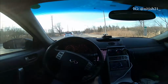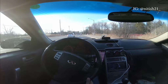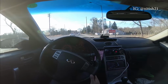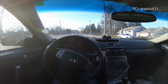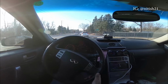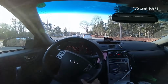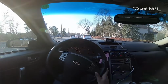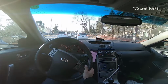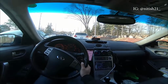Oil pump, it is recommended. You can get the rev up oil pump, or you can upgrade to the billet gear that I got. The billet gear basically is going to make sure that you can rev up to the higher RPM and make sure the oil pressure is good throughout the rev band. Other than that, you can pretty much run it on a stock head if you really want to, but again, I would recommend getting cams. I got the JWT C8 272 duration cams, so those are the ones in mine. And then we also got BC springs and retainers as well, just to make sure everything's able to keep up with the RPM and the valve speed.